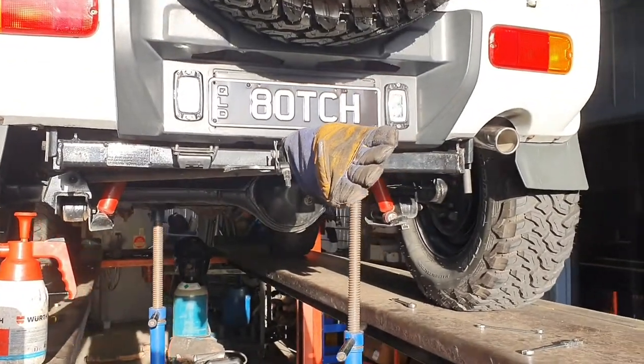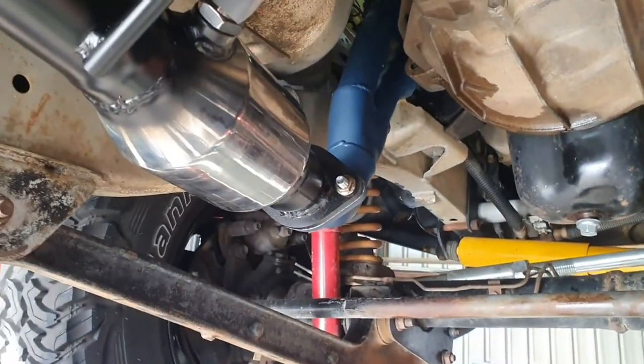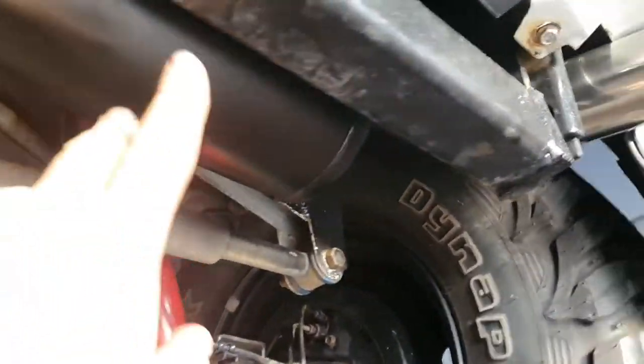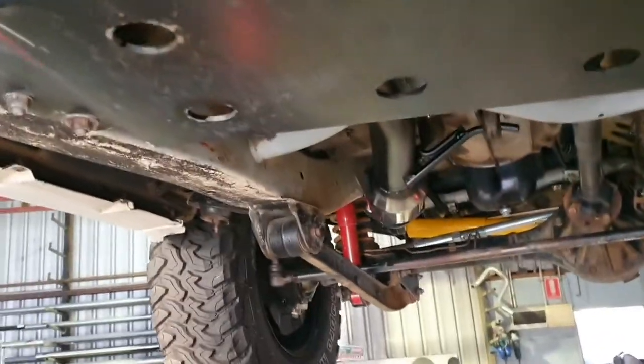I'm just going to adjust everything up, make sure we're nice and tight on everything - heaps of room in here, this worked out really well. I'm going to round my bolts one more time to make sure we're all good, then we can fire up. Start to finish: extractors, high flow cat with a 100-cell metallic core, cat stopper is in, all locked down. A big flex down to the bash plate, running a hot dog in here just to keep some noise levels down and get rid of that mid-level rasp. Up and over, then the muffler - two-and-a-quarter-inch center offset, straight-through full flow, chrome tip. The full system is 409 stainless steel, all MIG welded, flange joins everywhere we need them - so this is a serviceable item. If we need to do anything to the car, we can get things in and out with ease. The extractors were from Hurricane - good folks down at Hurricane, made a nice header for this car.